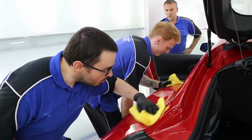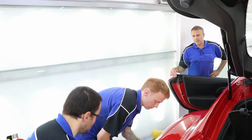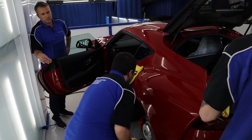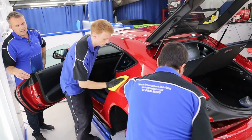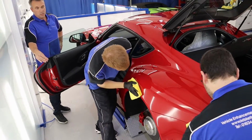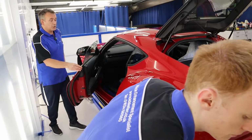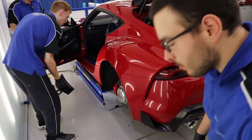Now, you have to appreciate this is how long it takes and how much work's involved in putting nano coatings on. But when you've got either semi-permanent, in this case a permanent coating that cannot be removed with chemicals, it flashes off, depending on temperature and humidity, between 30 and 60 seconds from when you're buffing, and then you only get a minute, maybe 2 minutes to fix any problems and issues with chemicals. After that, it's cured. You can't remove it. So you can see why they would now be checking with the light again.